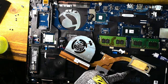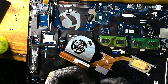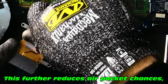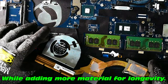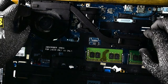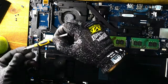There's more — putting some paste on the heatsink itself. This is quite unusual but I always do this to ensure a very nice mating surface; it also increases longevity because both surfaces are well lubricated. Spreading it out — this layer will be relatively thin — estimating where those IHS surfaces will end up. They won't cover the entire heatsink, which is actually a bonus. Now the final closing — difficult to place, but you want to get it pretty much spot on so you don't disrupt any paste.